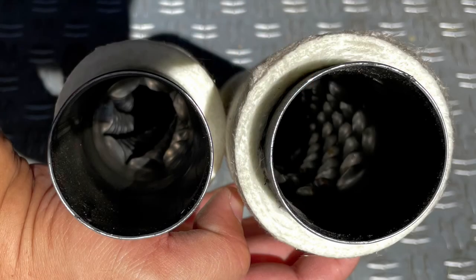I tried to take a picture of what the baffle looks like inside. It's pretty hard to get a good image because it's a pretty long section and hard to get the light through it. But you can definitely noticeably see that the quiet baffle is quite a bit smaller in diameter. Like I mentioned earlier, it has a shorter section that actually allows the exhaust air through it — so probably a little more back pressure, but makes for a bit of a quieter exhaust.